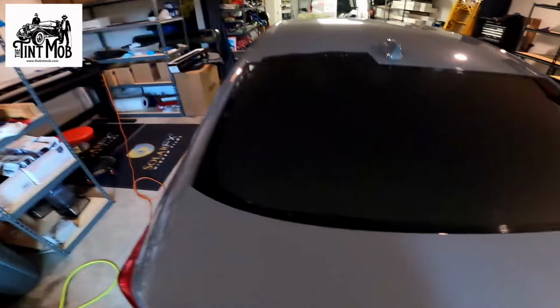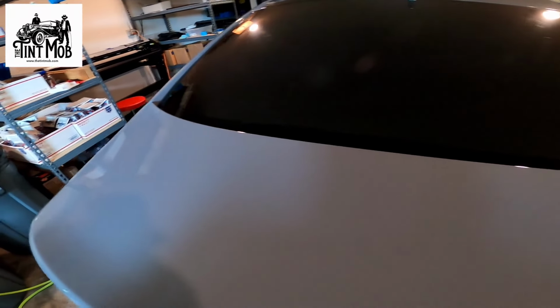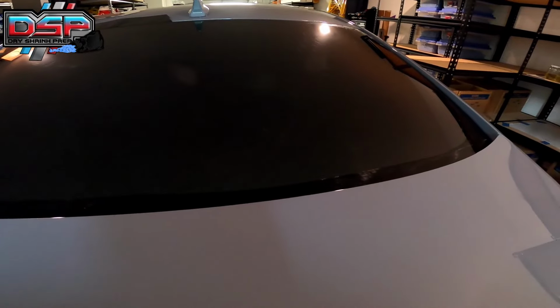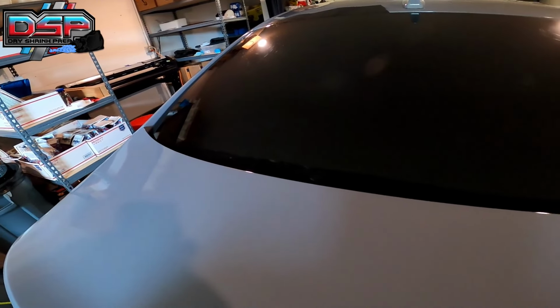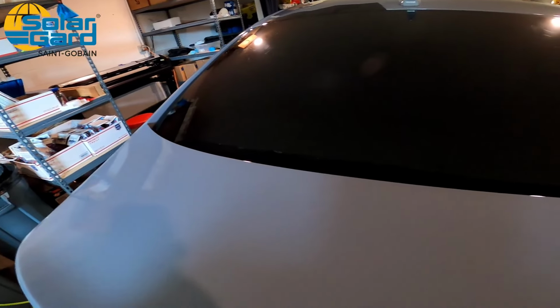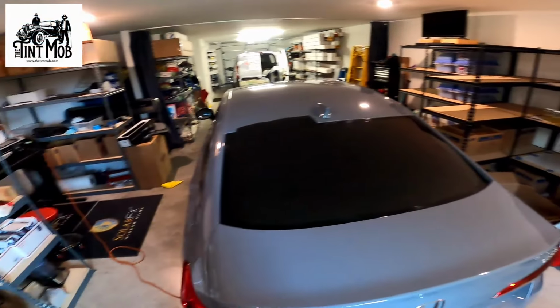But if we finish up the back window, look at that. Glass smooth. If it ain't glass, it's ass. And it's gonna be a hard time to install that window, okay? So that's your goal, flat, glass, just like that. That's how you shrink a back window. That's how you shrink side windows for a wet shrink.